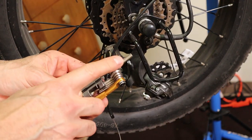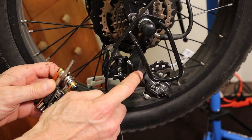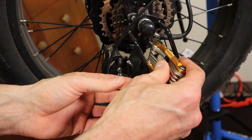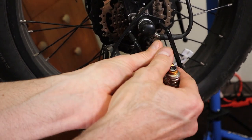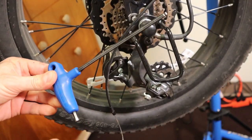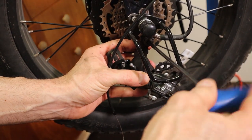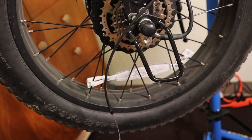On our multi-tool we want to find the 5mm Allen wrench. Just up underneath here there's a 5mm bolt that the derailleur is bolted into the derailleur hanger on — we want to go ahead and loosen that. It's kind of a tight fit to get in there with this cage on there, but you can fit it with the multi-tool. A tool I like to use is my handy 5mm P-wrench — I'll leave a link in the description below for this. Then I can just get in there and loosen that right up. This bolt you do want to take all the way out. So just pop that out. Now we have this old Tourney one — this thing can be set aside.